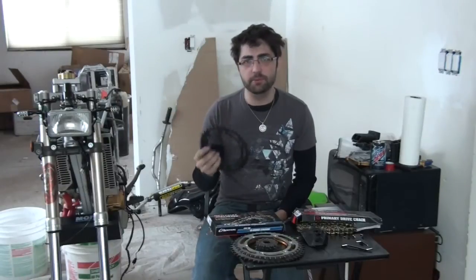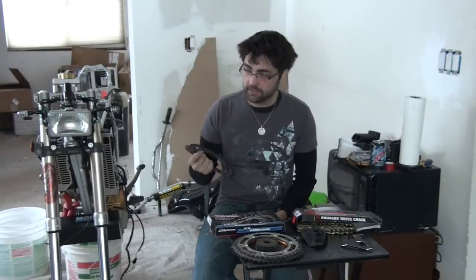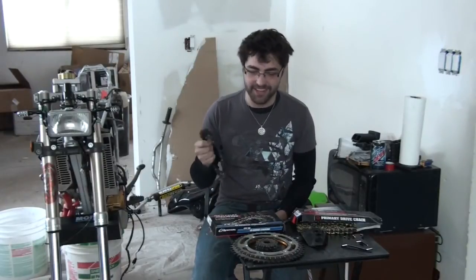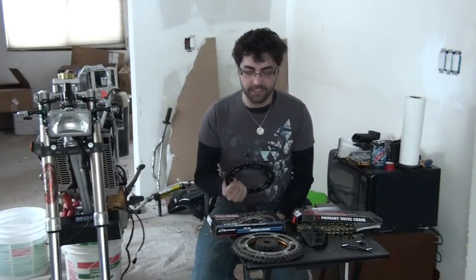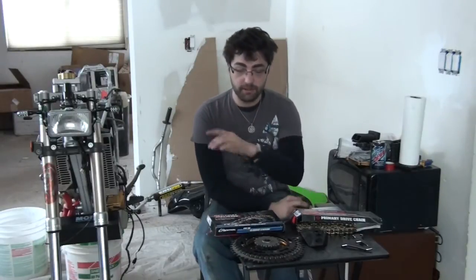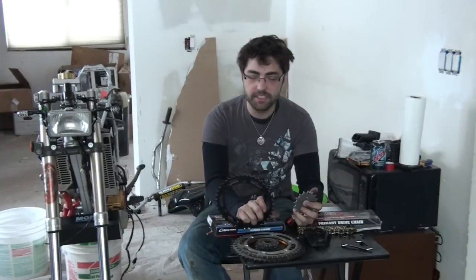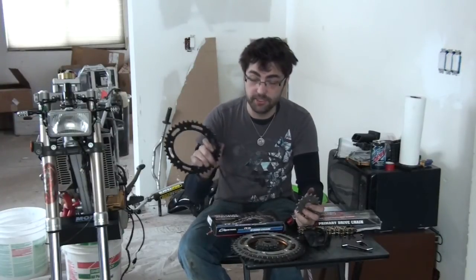It will certainly do more flat stuff, nothing with any too steep grades. If someone were to switch over to a supermoto wheel, it does technically increase the overall drive ratio. So since you can't go more than 15 on the front, you might want to increase it more if you go down to a 39 rear. There is a website, Gearing Commander — I'll put the link in the description — for calculating gear ratios, and it'll tell you at what RPM you'll be at what speed. The basic rule of thumb is for every tooth you drop on the front sprocket, it's the equivalent of adding 3 teeth to the rear sprocket.